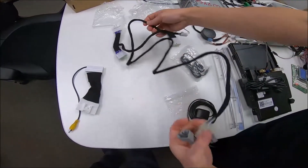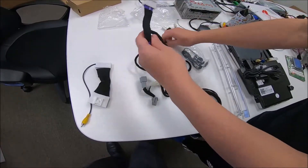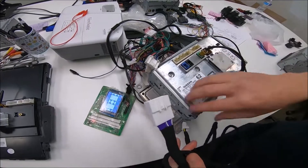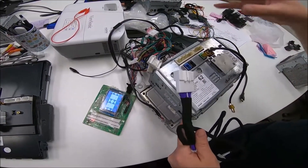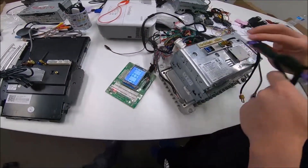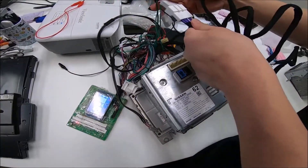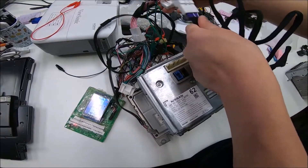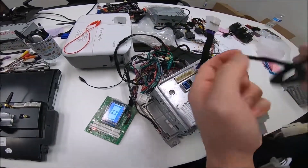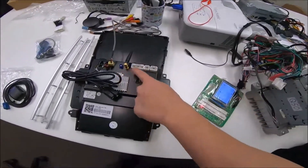Once you've made that connection — it's a pretty long wire — it goes from the steering wheel column, and this portion goes to the top of the screen. You can see we have a factory Q50 8-inch screen here at the top of the vehicle — you're going to leave that screen inside. Our unit goes on top of that screen and plugs in right here. You plug the factory connector straight back into our connector to make this T-harness connection.